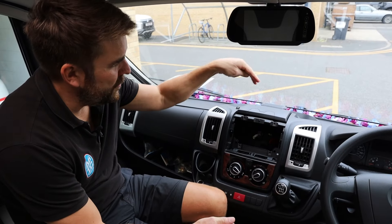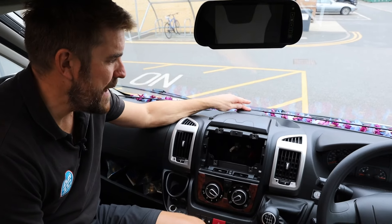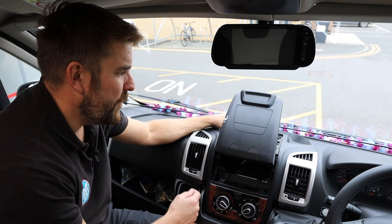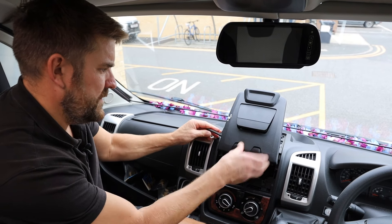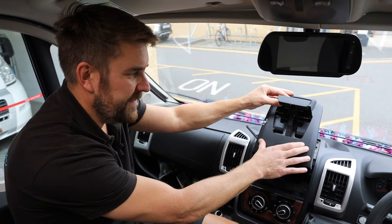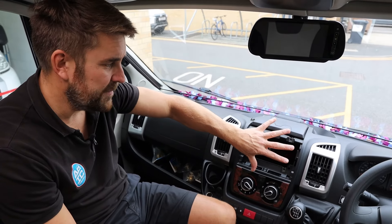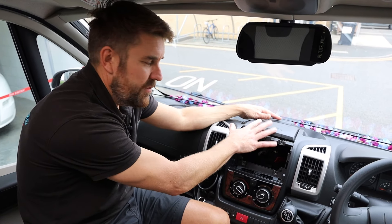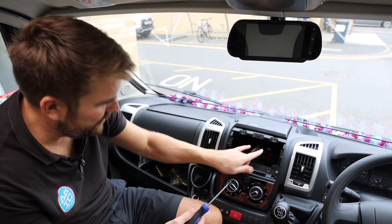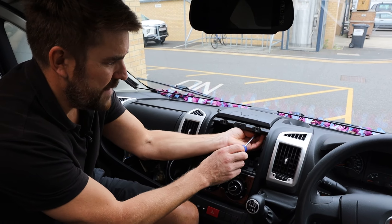The next part is to remove this upper section - depending on what vehicle you've got. I've got a 2009 and mine is just a map holder or document holder. This one is very different - it's a pull-up tablet-style holder where you could put an iPad or similar in here for mapping or navigation. As soon as we fit our new nine-inch system in here this won't be functional, but you've still got a clip and we're going to show you how to remove it. Again T25, two screws at the back and two underneath here - not really difficult to find. I'm going to put my hand in there so we don't lose the screw as it comes out.